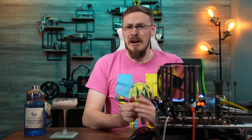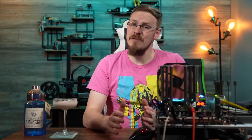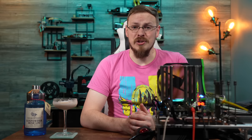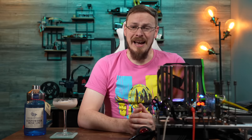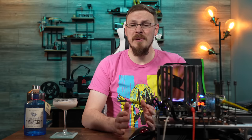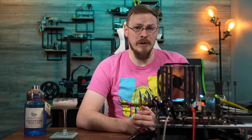As I started on this project around 6 weeks ago, you'll have to forgive me if I do repeat some of this from the first half of this video, but I want to make sure that all the information gets in here. Starting off, who would have thought the easiest part of this would be installing the MikroTik CRS504 switches? Well, if you've ever put something in a rack, yes. These are running MikroTik's router OS, and unfortunately switch OS is not an option when it comes to these, so you need to be a little bit more familiar with some of MikroTik's products, as well as some layer 3 networking concepts if you really want to get the most out of these switches.